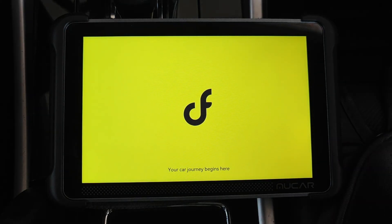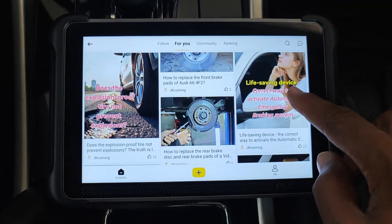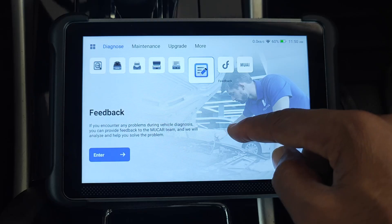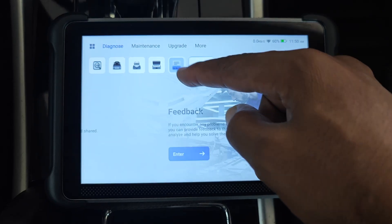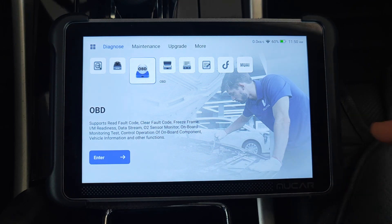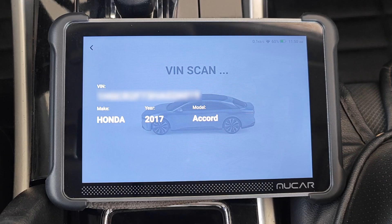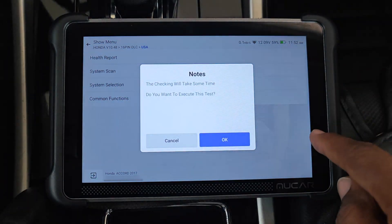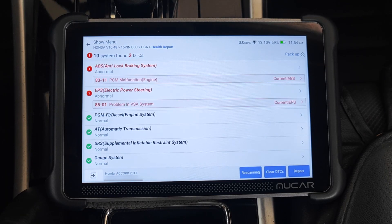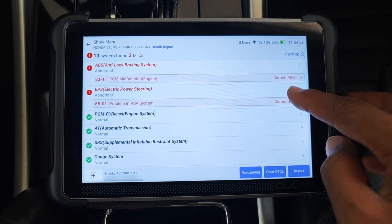DollarFix is another addition to the 892BT — it's largely a community where you can ask and post questions and learn automotive topics, though it's still developing, so don't expect answers to every query. Feedback is for sharing recommendations with the manufacturer. Reports and history are for accessing previous scans. OBD is for making a generic connection via OBD2 protocols. Diagnose is for manually selecting your car, while Auto Search automatically detects the VIN. The tool identified the VIN and I finalized the car selection. I started with an all-system scan, which completed in 2 minutes 4 seconds and correctly identified all 10 modules on this car.